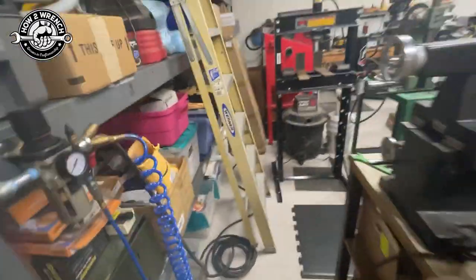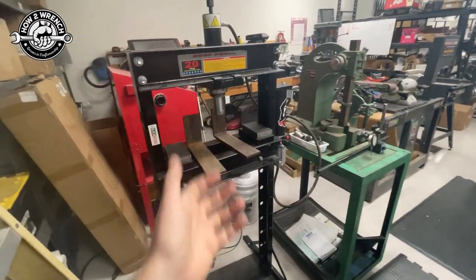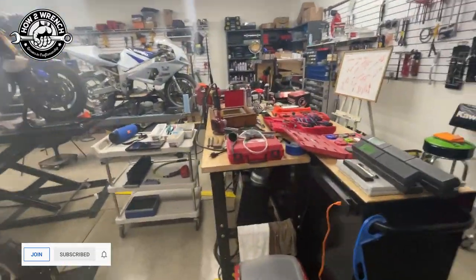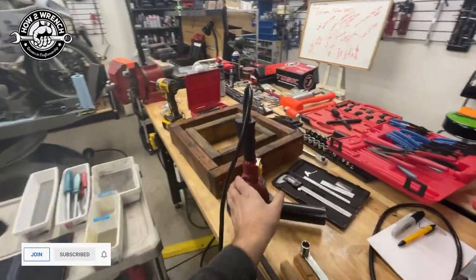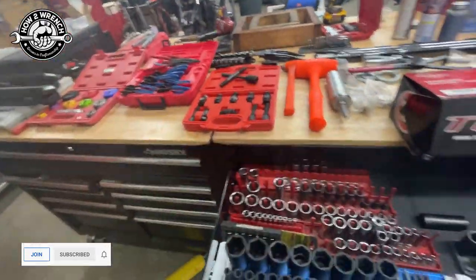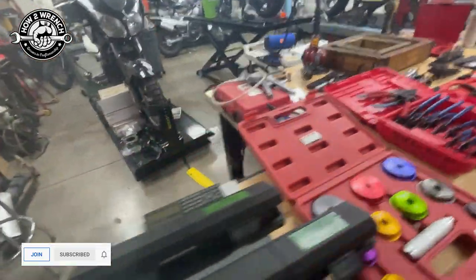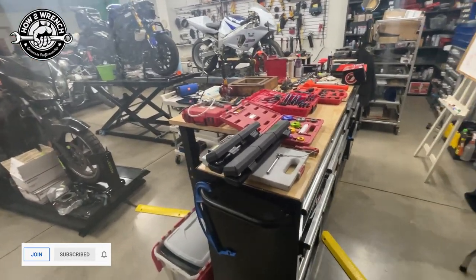I've got an airline here if I need it, and I'm going to press bearings in and out using either my arbor press or hydraulic press — whichever is more convenient. There's a little more cost there, but maybe you just get it apart, take it to your local friendly shop or a buddy with a press for that last bit. On most two-strokes and four-stroke vertically split cases you can heat it up enough to drive the bearings out with big hammers or large sockets. Please like, share, and subscribe, and if you're a member head on over to part two of this series. As always, my friends, keep wrenching.